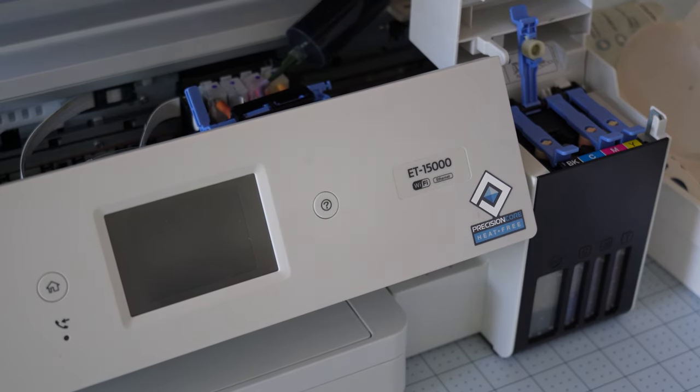Once you know there's no ink flowing, take out this next piece — I believe it's connected to the printhead area. We're going to take that little tank out and remove the extra ink you can see spilling out. Use the same green syringe and suck out as much ink as you can over a tray, since it can get very messy. Just use a tray or plate so you don't spill ink everywhere, and suck out as much ink as you can from that little cartridge.